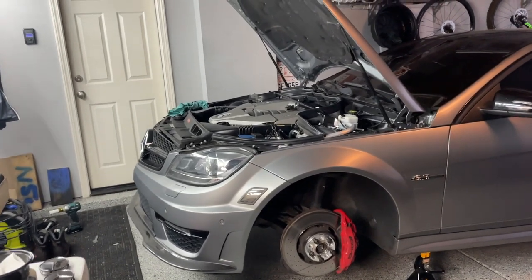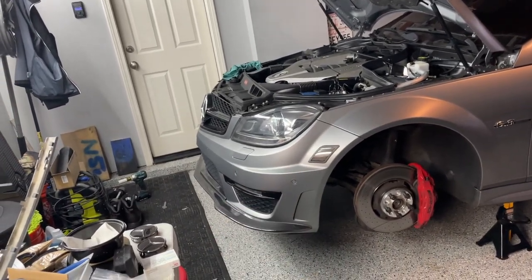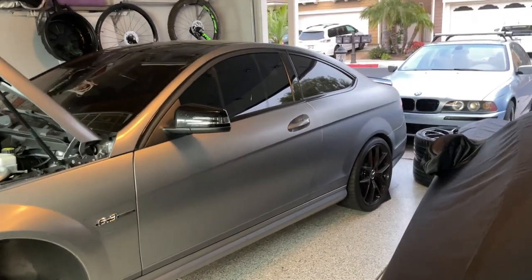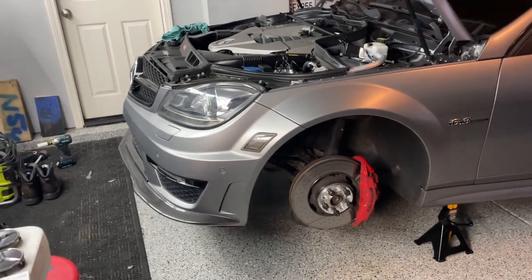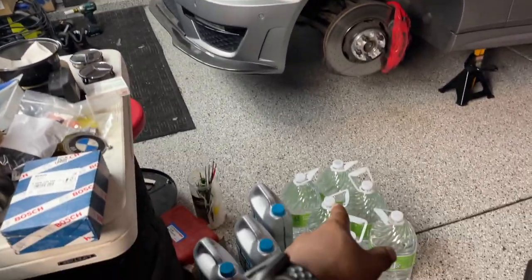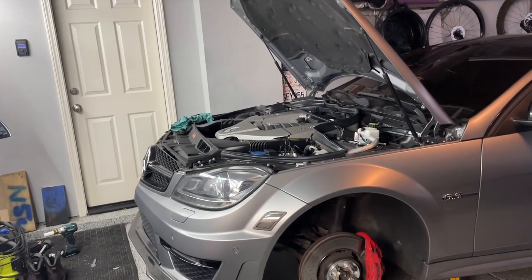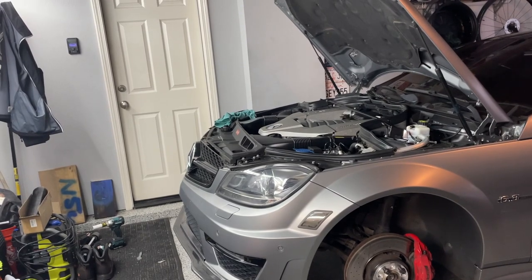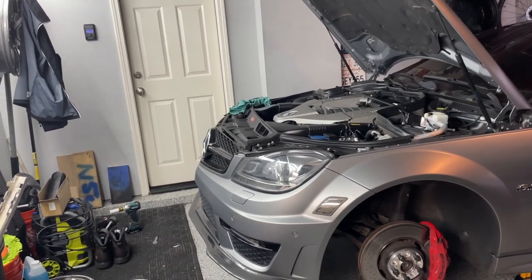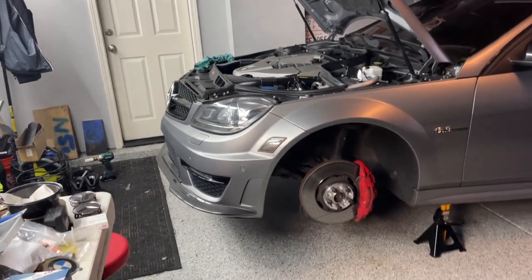You're going to want to lift your car up — at least the front end, since that's where the radiator is with the bottom drain plug. I'd also recommend lifting the rear of the car to get more of the coolant out by gravity from the block, heater core, and other areas. We'll use distilled water to flush out the heater core, and we can put the thermostat up in the car later. The system is self-bleeding, so it'll be very easy to just fill it up at the end.